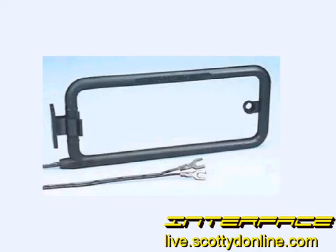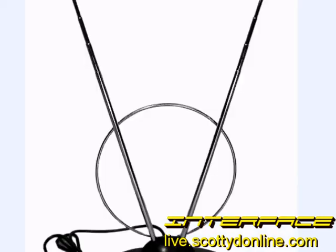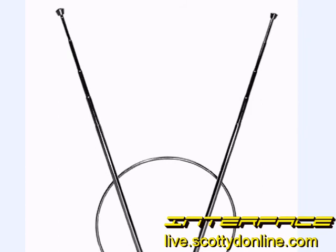The next thing to consider are antennas. If you plan to use the radio a lot on your receiver, you'll need to make sure you have the proper antennas. Most new receivers come with antennas supplied, but you may want to upgrade. For AM, a simple loop antenna is usually perfectly acceptable. Older receivers can have an AM bar antenna built onto the back. If you really want to get jazzy, you can set up an outdoor antenna for AM, and there are usually terminals on the back of the receiver for that. For FM, a great set of rabbit ears is perfect.